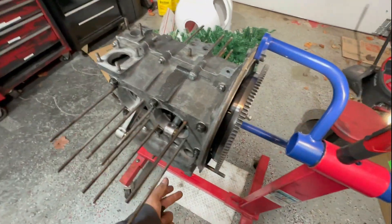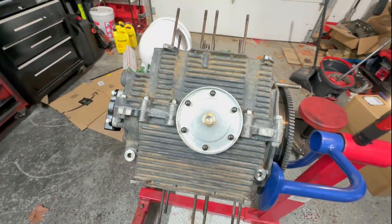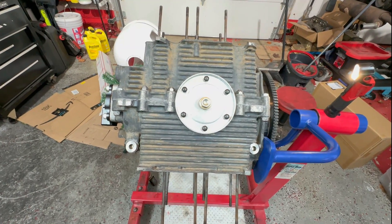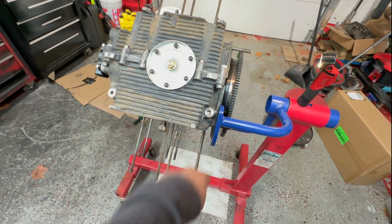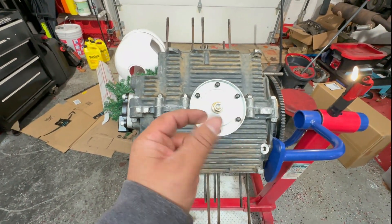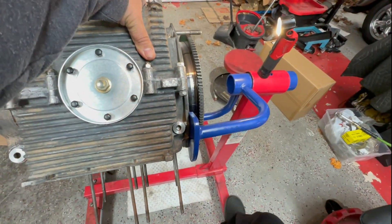There's a new oil plate on the bottom — it's not really an oil pan, more of an oil plate. This is a Super Performance oil plate; it came with the nuts. Make sure you put the copper washers in for no leaks. There are also hex head high-performance oil relief caps — they're easier to torque down than a screwdriver slot and also have a copper washer, which is nice.